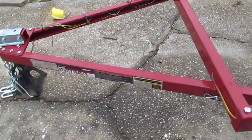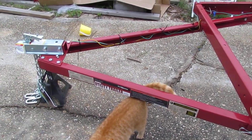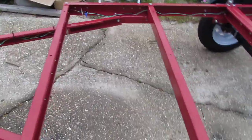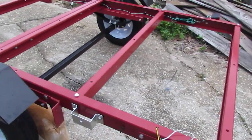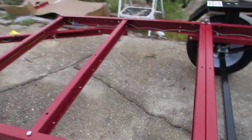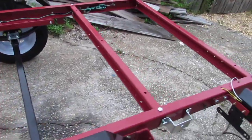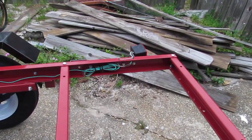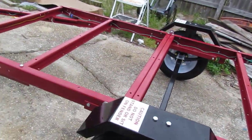It doesn't come with a front stand or wheel caster — you have to add that, about $30 extra. It also doesn't come with decking; I wanted to show this before the decking was done to show more detail on how it's made. You have to add a piece of plywood. For the folding feature you'd split it into two pieces and leave plenty of slack in your lights so they don't stretch. I left spare wire on board, but I'm not going to use the folding feature anyway.